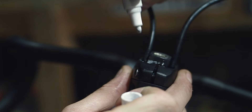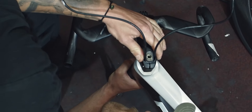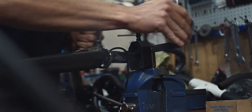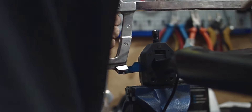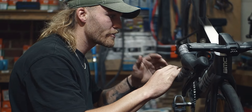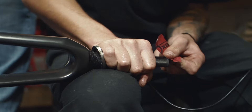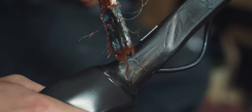We make a mark on the old fork because we make it a little bit shorter for the new setup, and it looks very nice and clean to cut it. Be very gentle when you cut the fork because it's carbon fiber — put a little bit of water inside, don't sniff the dust, it's not very healthy. Then we sand the fork on the top to make it very nice and clean, which is good for the customer.